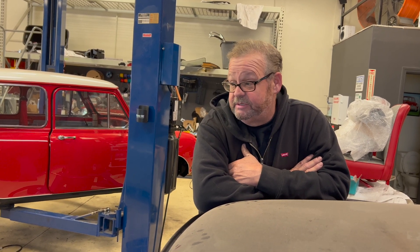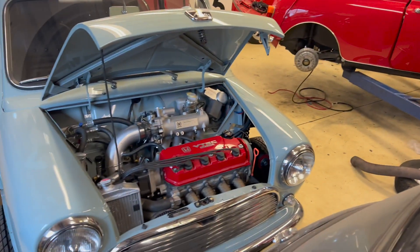Pushing beyond that, you're starting to ask a lot of a stock bottom end. My thoughts go back to about five years ago when I did a turbo system from scratch — it was for a Buick Grand National motor, a twin turbo deal. The fabrication was wonderful, a work of art. But developing the car was a whole other nightmare. We ended up a little north of 500 horsepower trying to keep it reasonable — about 15 pounds of boost. That's a whole different game. We went through two engines. Building a turbo is one thing; developing it is a whole other deal.